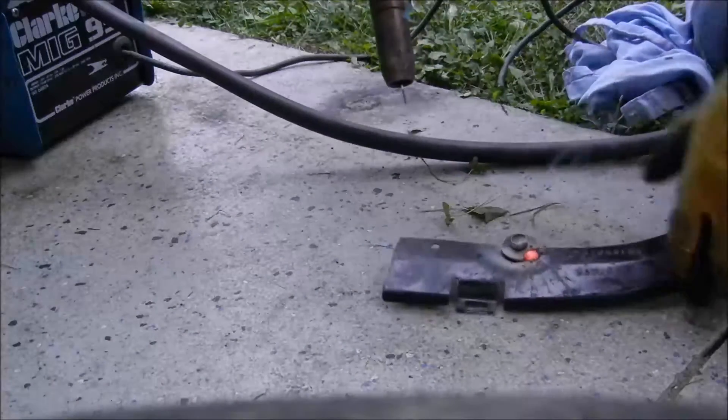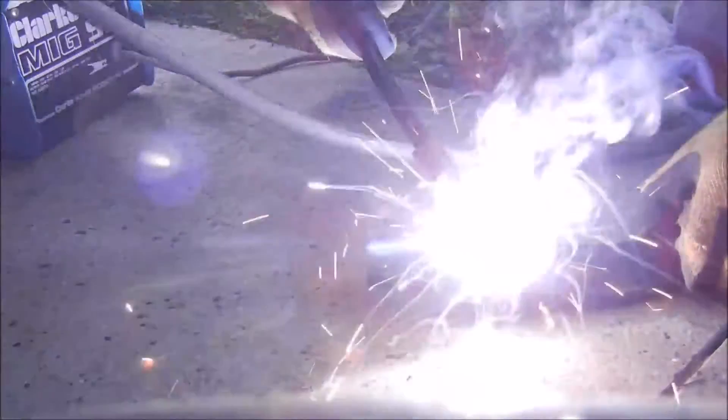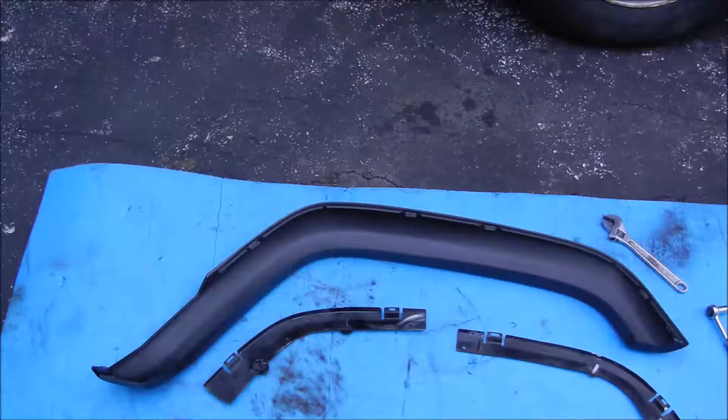The reason you have to do this is because once you've got them on, you can't get up inside there and hold the nuts from spinning while you're tightening them down — tightening the fenders down. So just tacking up some new bolts.